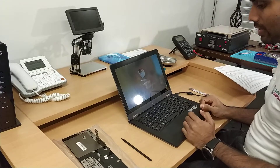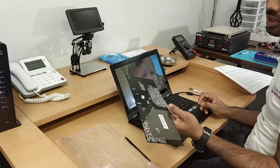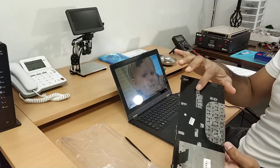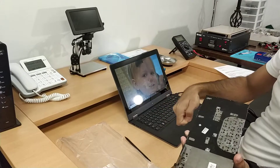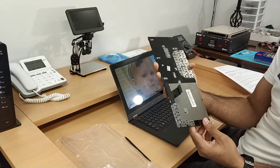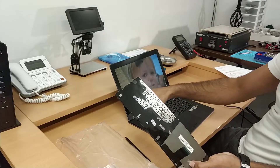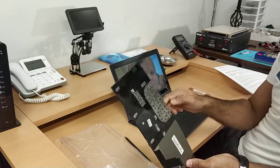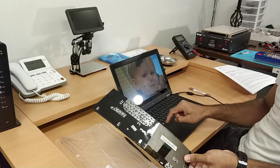When we unlock the old keyboard, we have to do that carefully because there are four total metal locks — not plastic locks — and they hook into the palm rest. So be careful: if we do it unprofessionally or carelessly, it can break the locker into the palm rest. We don't care if the old one breaks, but we have to be careful with the case lock.